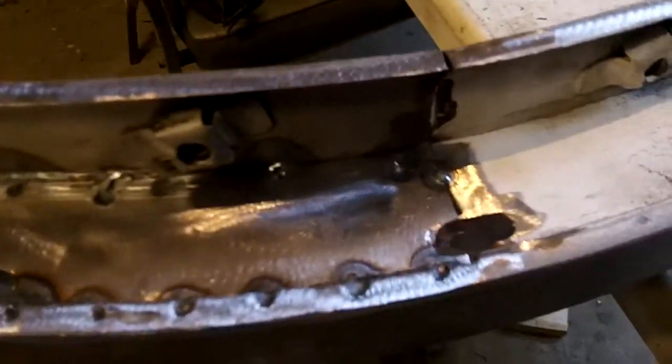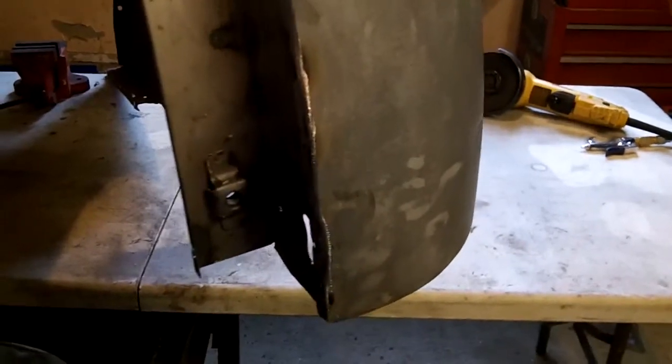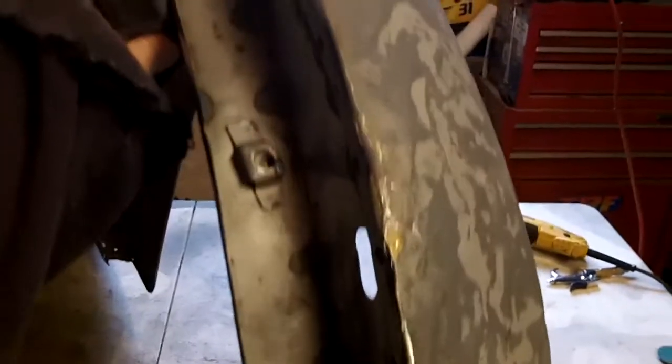Quick update — I've got that piece welded in now. It is looking better. I haven't quite finished welding the top; I've just got a tack there on the top and a couple of tacks on the bottom. I just need to finish weld that. It looks okay — better than it was, let's say. It's still not perfect and I've actually discovered there's a little crack in there. You can see where that little bit of bondo is — there's actually a crack just right on the edge of the fender where the metal has gotten very weak and thin. I think the flange is much, much better than it was. I am going to put it up to the valence and give it a quick test fit. It's not perfect, it's as good as I can get it, but it's much better than it was.